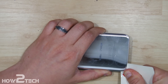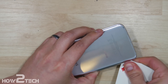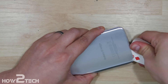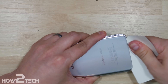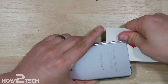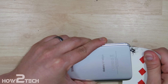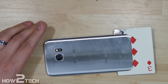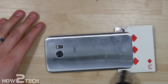This has a much shallower curve than the S7 does, so it's not as easy to work around the corners. As you move the card around the corners, try to not use a whole bunch of the card there — just kind of the tip area. You can see we're making quick progress on this phone. When you're putting your card in, you don't necessarily want to go too much further up than the S7 Edge logo on the back, as there's a charge mat underneath it from the Samsung logo down.